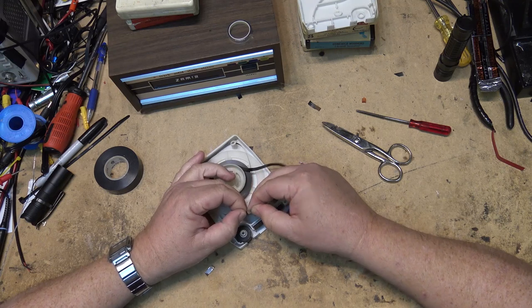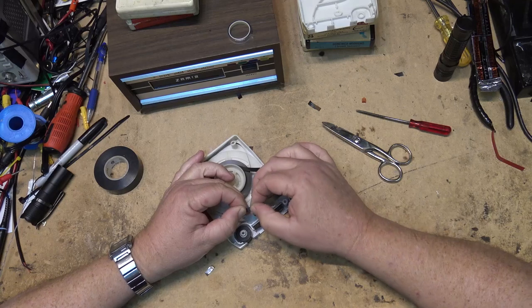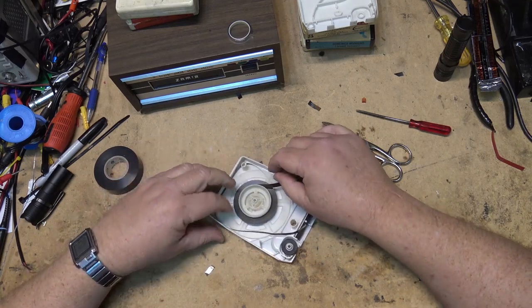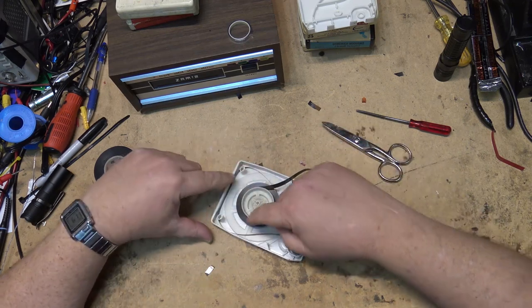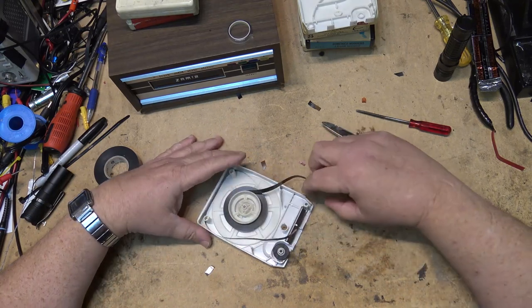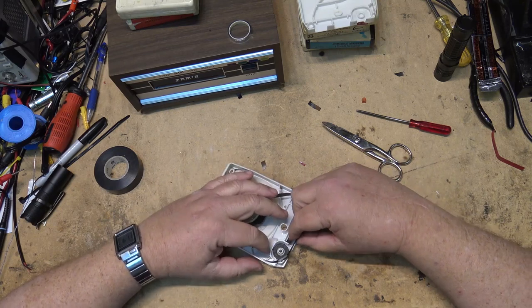And that's another way you can repair them. You can splice them with conventional tape and then put the sensing tape over the front. Now, I don't know why it's been looped around this way. Different cassette designs. This one here actually loops around. You can see where it's gone around the posts at the back. Why they've done that, I don't know, but some of them did.